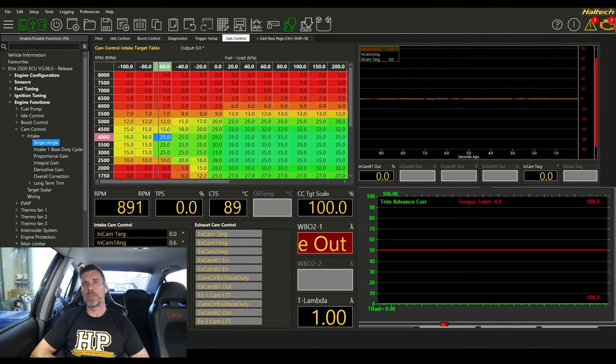If you don't get your PID right, you'll struggle to get good control of your cam timing, boost control, or anything else. These terms don't really mean anything to most people without an understanding of PID algorithms, so here's a real-world analogy. Imagine you're on a straight road, 100 metres from a set of traffic lights. Your aim is to accelerate to the lights and stop as quickly as possible. The proportional gain is like only having the accelerator pedal available — its effect is proportional to the size of the error.